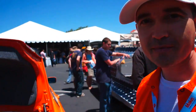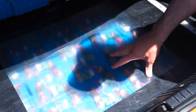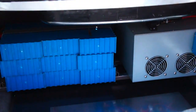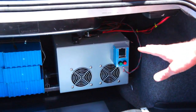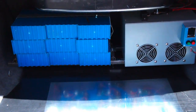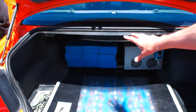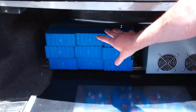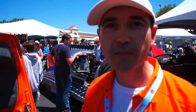So we're now at the back of the car. Can you show us what's typically installed in the back of the 3 Series? So in the back, in the spare wheel area, this is the third major pack. Each of those packs are about 10 kilowatt-hour packs. In this particular car — this is a prototype — we have the charging system right here, which is a 12 kilowatt charging system. It recharges the car in two and a half hours from a compatible outlet. This is a 60 amp circuit, similar to a typical circuit you would find in your house for an electric range. And there is also an auxiliary battery pack, which in the production model will be under the car. That setup gives a range of about 100 miles.